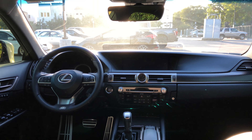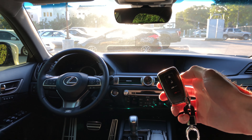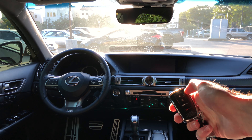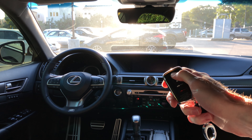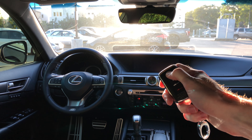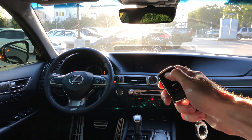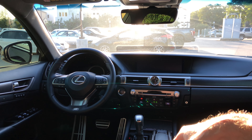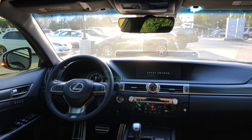Here's a demonstration from inside the vehicle. The vehicle is currently unlocked, so press lock — you can see the mirrors fold in and the car beeps as it locks. Then press the lock button three times, holding on the third press. This can be a little tricky to get right the first few times, but you'll get used to it. Once the vehicle turns on, the turn signals flash a few more times to confirm.